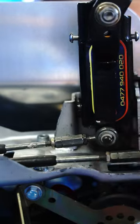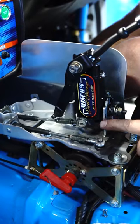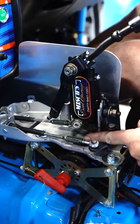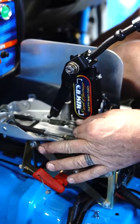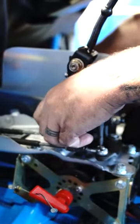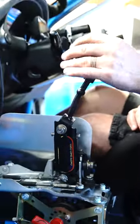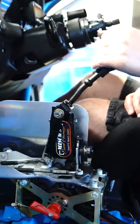Another really good tip: once you've made those adjustments, just to make sure that you haven't put extra tension on the cables or anything, just make sure you can slide the cable off and make sure it's in its horizontal position — it's not twisted. Because what that'll do is just put extra strain on the cable as we go. Put the locking clip in. So these two adjustments are done. Side-to-side shifter movement's done. Forward and back throw is done.